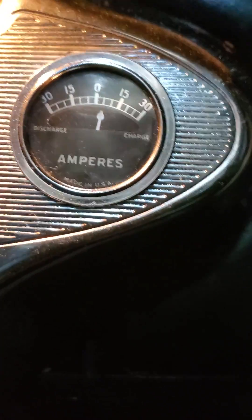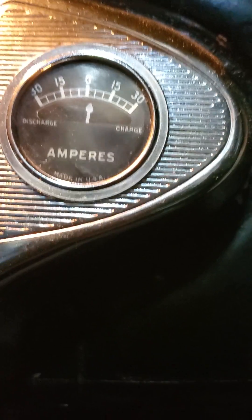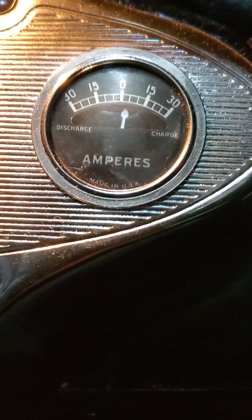See, my headlights are on. John, these are the focus beam LEDs. And even with the third brush adjusted all the way down, as low as it'll go, with the headlights on, I still get a slight positive charge.